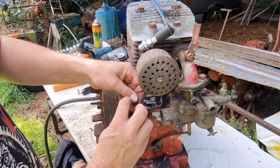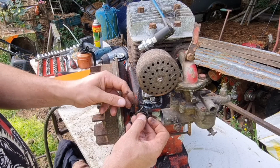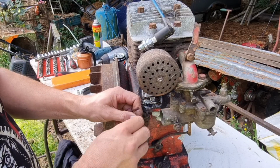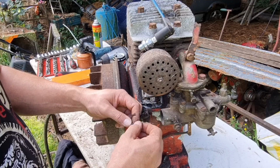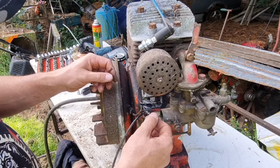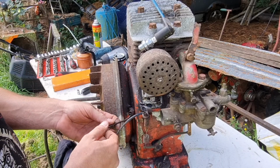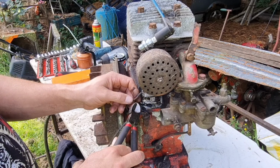There we go. Now we're left with some nice... Oh, that's come off there, look. This wire is quite badly disintegrated, unfortunately. This might be where our problem is, you know. That all the inner insulation off this wire has gone. And it's earthing out.